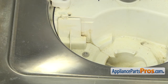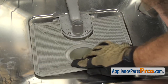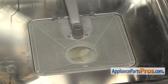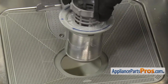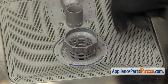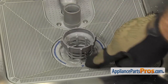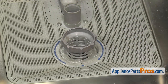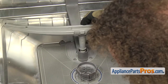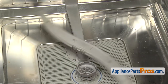Now that we have the cover on, we can put the filters back in. To put the filter screen back in, all you have to do is slide it up into place. You want to make sure it goes underneath these two tabs right here. Once you have it in, we can put the micro screen basket in — just set it in place. You want to make sure the blue arrows are at 9 and 3 o'clock, then turn it clockwise so the blue arrow comes down to this arrow. Once you have that in place, we can put the lower spray arm back in. All you have to do is set it into place and snap it in. Once you have it in there, you want to make sure it spins freely.